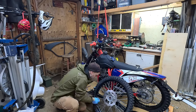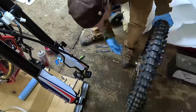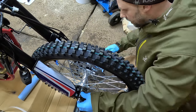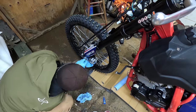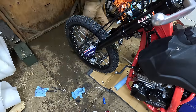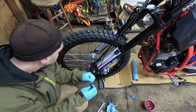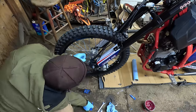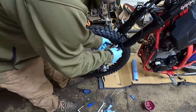I'm cleaning up the rotors and pads with brake cleaner to remove any shipping or packing grease. I'm lubing up the axle and putting a little grease on the bushings and seals so it doesn't seize later. Once the pads get scrubbed in and broken in, they work pretty well — the brakes are pretty decent on this bike. After mounting the caliper, I'm working on the little speed sensor that runs off magnets on the inside of the rotor. I'm pulling all the stainless hardware and putting a drop of blue Loctite on each piece so nothing rattles off on the trail.